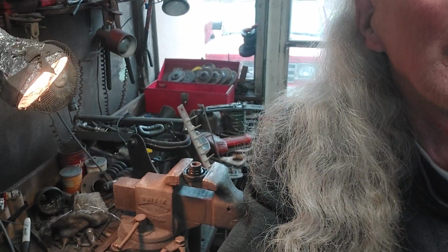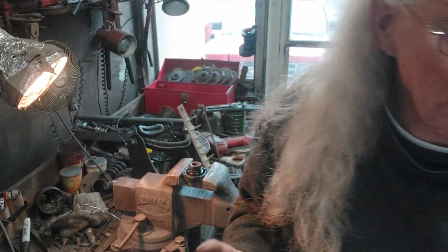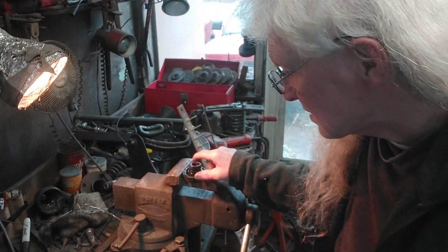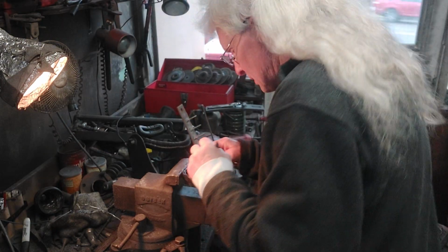Give me a second. We're 41 minutes into this. I'm gonna have to gut this old cap. That's not circulating, and with two pressure caps, it's gotta build up 8 or 15 PSI before this cap would open up. But this is the 18 PSI. I'm just going to gut it. At least I hope to.